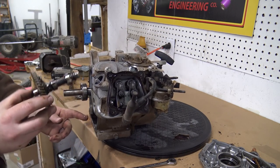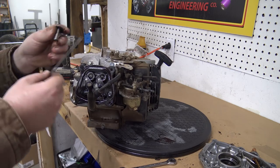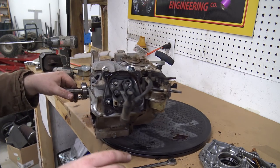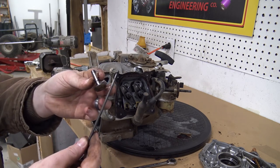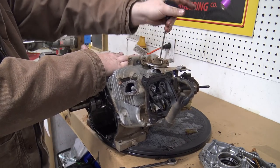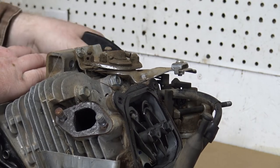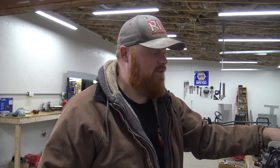Oh great. I forgot to put the side cover back on to hold the cam in. My bad. So I'm just dropping the tappets and the push rods out now. We'll reinstall those and hopefully it's okay. It's very strange. There wasn't much water in there from what it looks like, but I got both those push rods and tappets out. We can still pull this thing over though. Oh yeah, did you guys see that? I'm guessing the trash bag I had on this engine wasn't guarding it well enough and water got down the cylinder. Seems like everything is okay though.